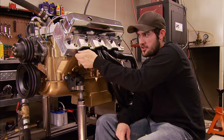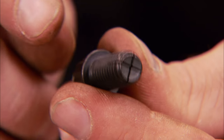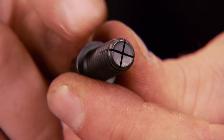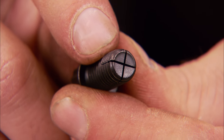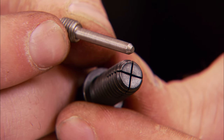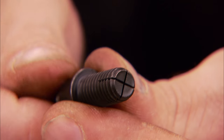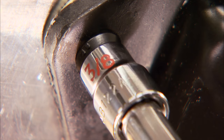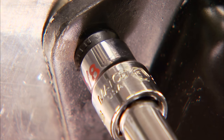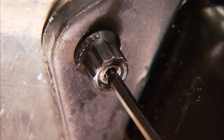You probably noticed these fasteners look a little different than normal, and that's because they are. They're friction lock fasteners from Percy's — they cut two grooves in the end of the threaded portion of the bolt, and an Allen set screw with a leg expands the end of the bolt once it's tight so you won't have a leaky header. Since it's a three-eighths bolt, torque it to 28 foot-pounds, then using an eighth-inch Allen, tighten the set screw.